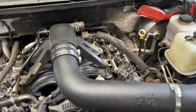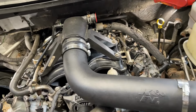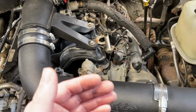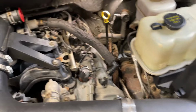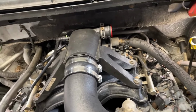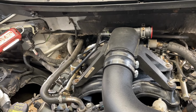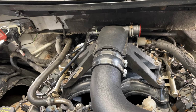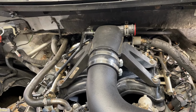Once it idles down, it's really loud on that side there, indicating the baffle's come apart. So on these engines, like I said, the flex fuel is inferred from the mass airflow sensor being skewed from the cold air and the baffle being broken inside of there. Also, 09 and newer, Ford went to the new style canister purge valves that were really troublesome for sticking open, causing the vehicle to stall, hard start sometimes, and of course, rich codes.